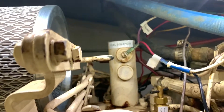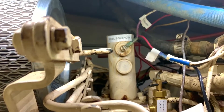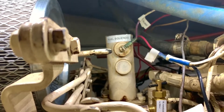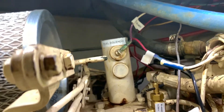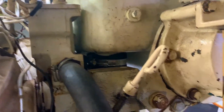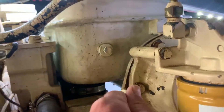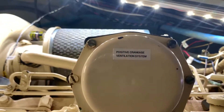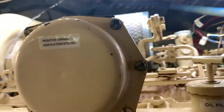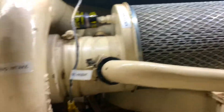In order to start the engine, the fuel solenoid turns on and allows fuel to flow. In order to shut the engine off, the fuel solenoid is deactivated and the fuel flow is cut off — and that's what shuts the engine off. Here's our dipstick for checking the oil and our oil filler cap. This is our positive crankcase ventilation system which takes the oil steam out of the engine and circulates it back into the engine to re-burn.